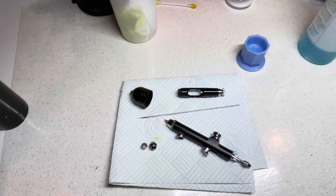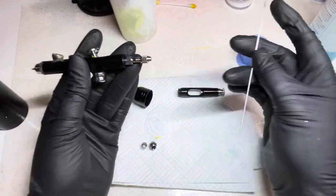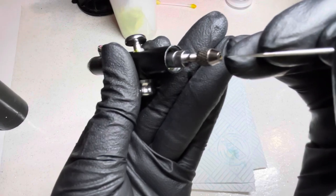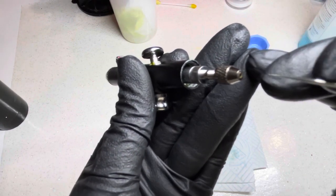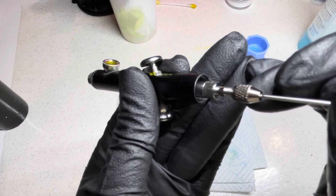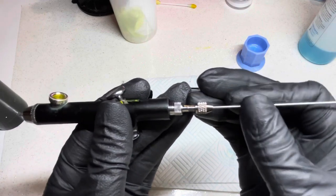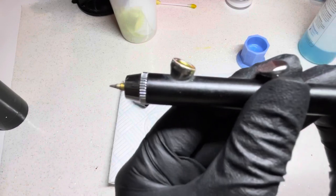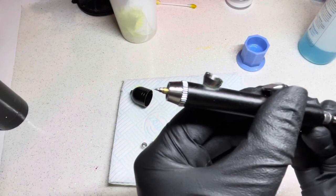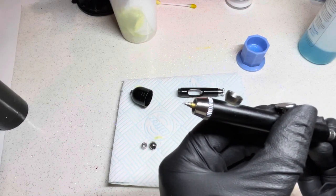Right, so next I'm going to put it all back together again. To put it back together I'm going to start with the needle, and I'll tell you why. When you're putting the needle back in you've obviously got the hole there, and you have to be so careful and make sure that the needle is spot on before you push it in. Gently thread that back in — you can do quite a bit, but then you slow right down because when it comes out of this end you don't want to force it. You just need the slightest little bit coming through this end. I can feel the resistance now so I know it's going to come through there in a second.